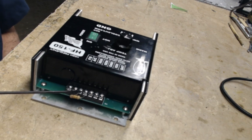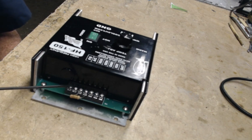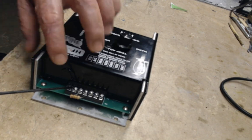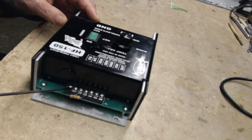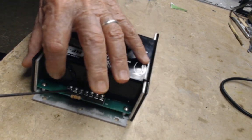Also, either sensor wire should not be shorted to chassis — if it is shorted to chassis, your controller will not work. Pin 6 is the AC input for 12 volts, and pin 7 is grounded for fail safe.